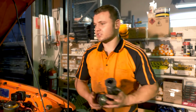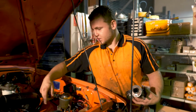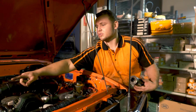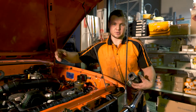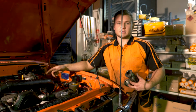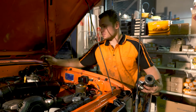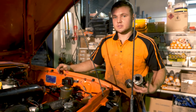On this motor, you've got to set up where your crossover pipe for your air intake is. There's a breather off the tappet cover. Most people reroute them into there, but because I've gone with this pod filter design and I didn't really want to reroute the oil back through the system, I wanted to run a catch can instead. Just makes things a bit cleaner. So I originally just had a hose coming off the breather into a beer can, and as you can see, that didn't work so well.